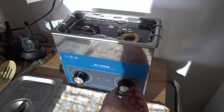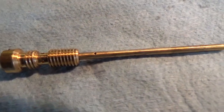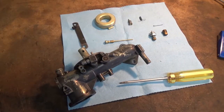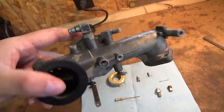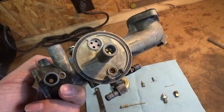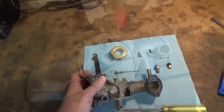With a clean workspace, I'm putting the carburetor back together. The float came out nice and clean. The metering jet has tiny holes all the way down the shaft and at the top, so I'm using an oxyacetylene tip cleaner to poke through each one and make sure they're clear of debris. The carburetor itself came out pretty clean — there's still some old paint on it, but the inside is clean, especially where the float and bowl go. I've put the main jet back in and blown it all out with the compressor.